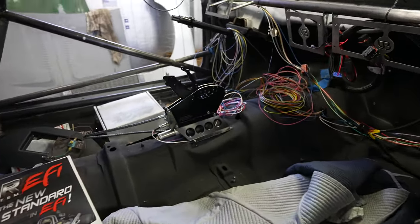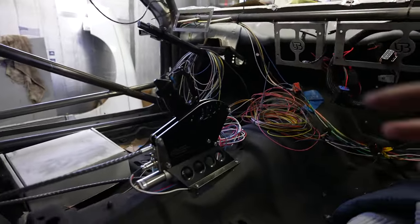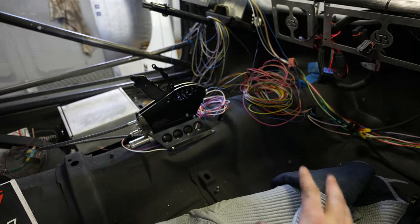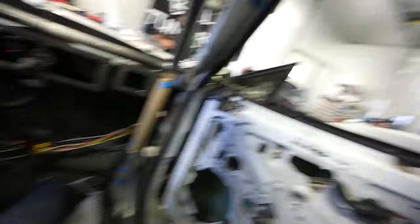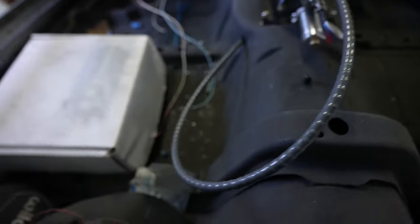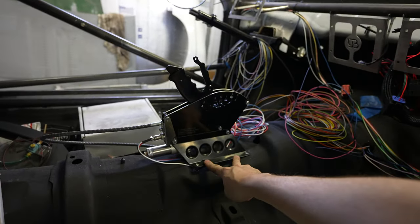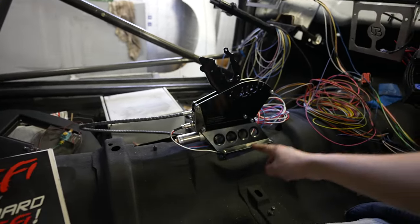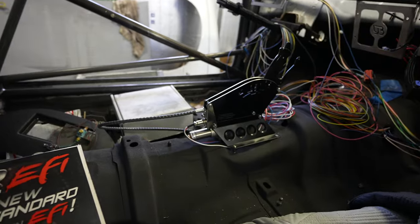Working our way up to the front of the car. We ended up getting our PPP shifter — the Precision Performance Products shifter — in the car. I went with the all blacked-out version; I think it looks super sick inside with the floor being black too. I also went for the optional air shift so I can hook up an air solenoid, and the Holley will trigger the shifter at certain RPM points so it will shift itself. We already drilled the hole, ran the line down through the floor, and hooked it up to the transmission.